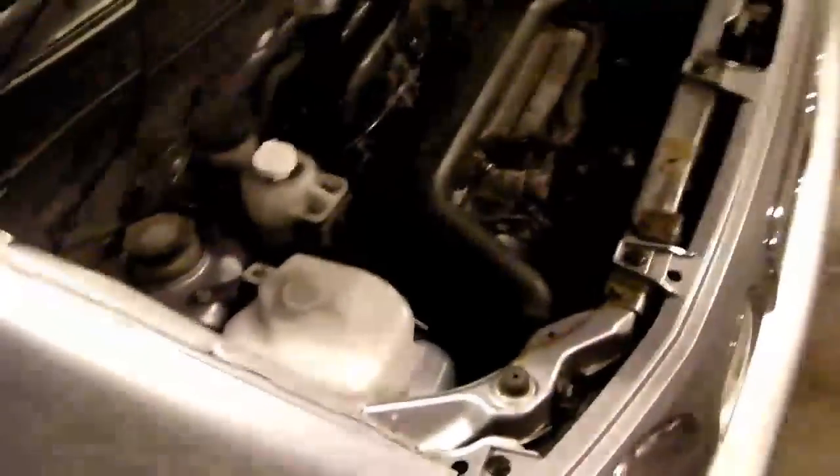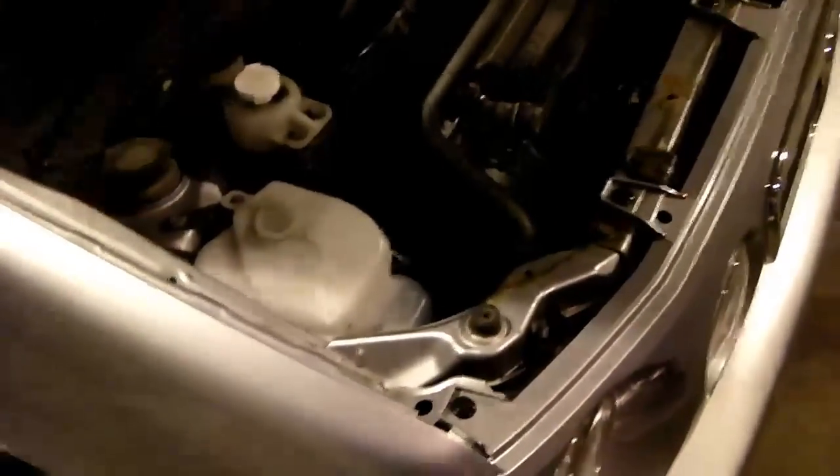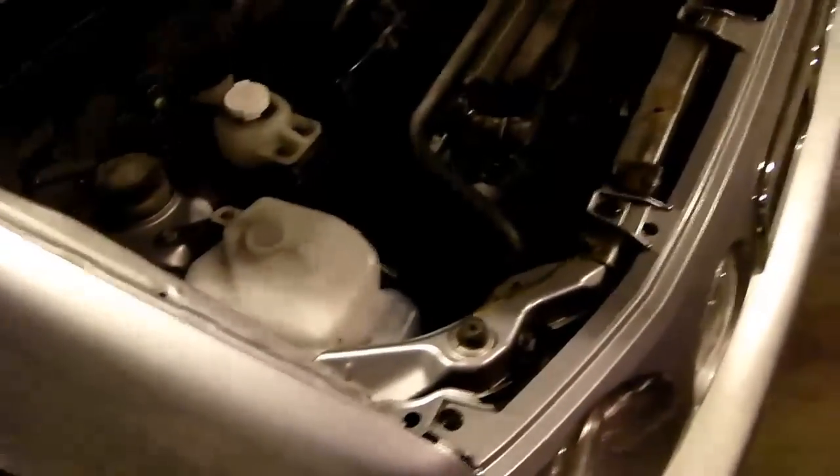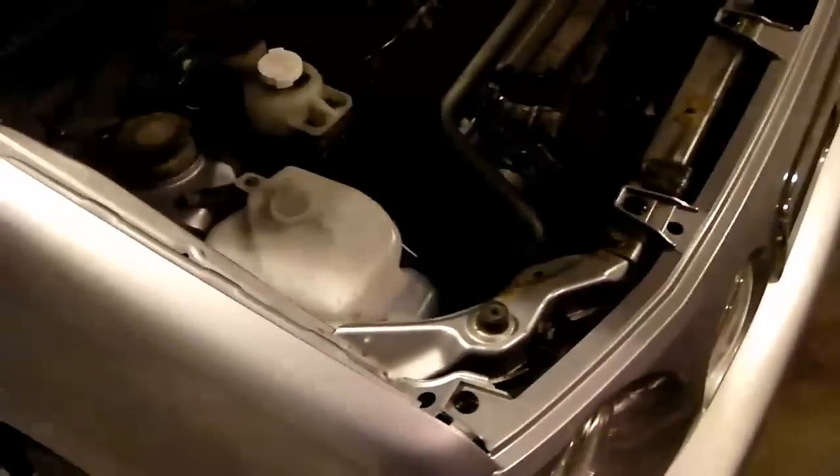I managed to get it to click about 65 or so, definitely, and I think I maybe did about 70 odd, but when you're doing this single-handedly, it's very, very hard to do. Ideally, the easiest way to do this is to put it in gear and get a friend to stand on the brakes while you actually torque it up, which is easier said than done when you don't have a great deal of access and leverage. So I'm going to have to get that double checked.